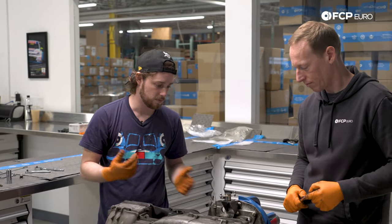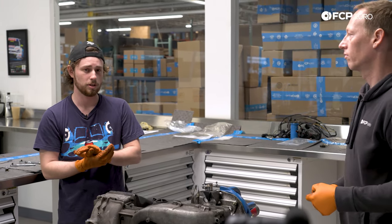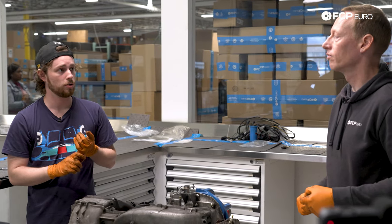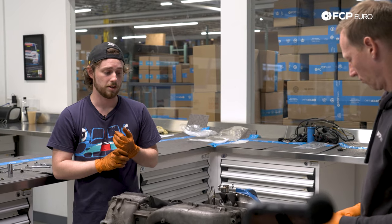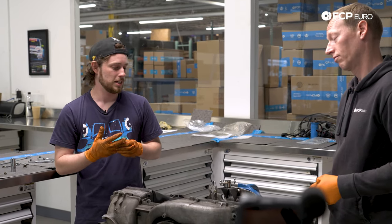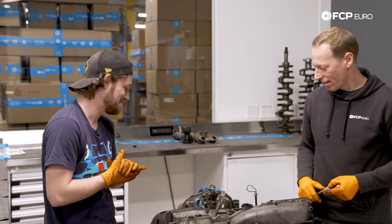On just about all of these — your 1.7s, your 1.8s, and your 2-liters — the common upgrade is going to 96mm pistons. That's larger than the 94s in your 2-liters, the 93s in your 1.8, and the 90s in your 1.7. That's pretty much the go-to, but you can go quite a bit bigger. People go up to 103, up to 106. This may have that — we're going to find out eventually.